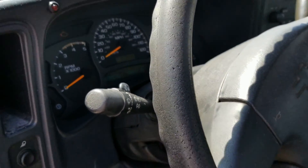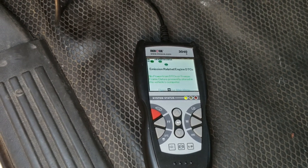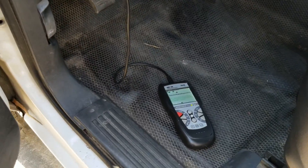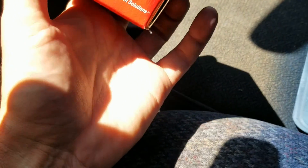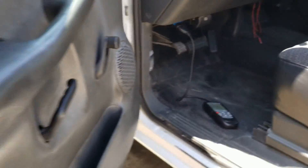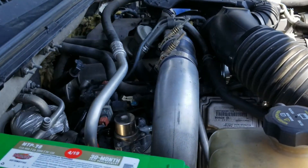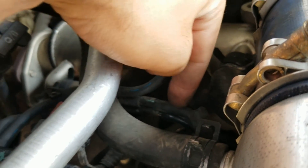We are all green! So that was the problem. I would imagine it was partly due to that vacuum line that was like 90 degrees and pinched, and then maybe that damaged the solenoid — who knows. Pretty exciting. Let me get you the part number here — so this was the solenoid, I got it through O'Reilly's. So basically I had that P0404 code for the EGR open, and I went ahead and checked if I had vacuum using this hose right here.